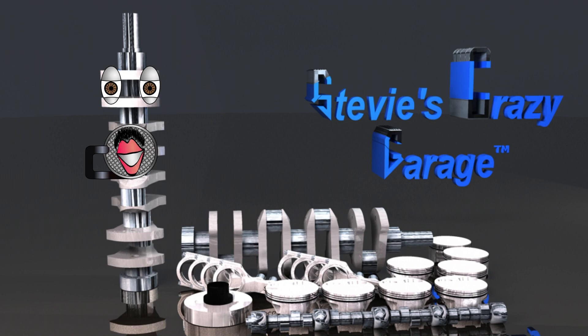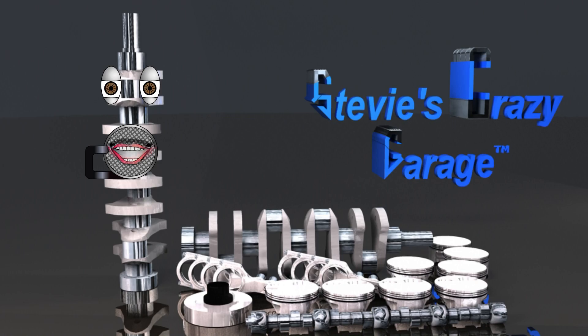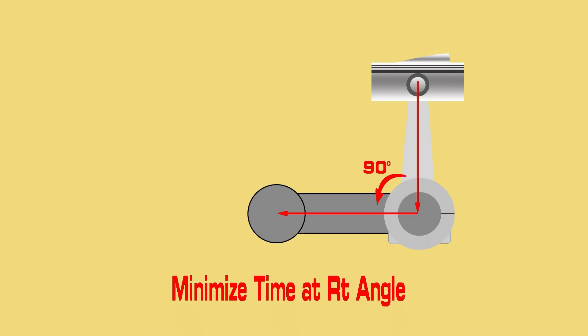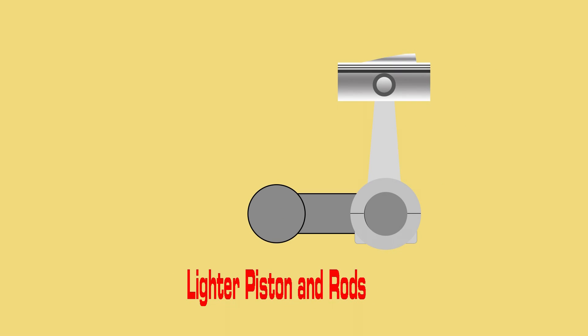To stop this, all the components — pistons, rods, rings, pins, bearings, and the dampener — must be designed together as a single operational unit. The main goal of the design is to minimize the time the piston assembly is at the right angle to the crankshaft rod journal by shortening the stroke or lever arm and using very light pistons and rods.